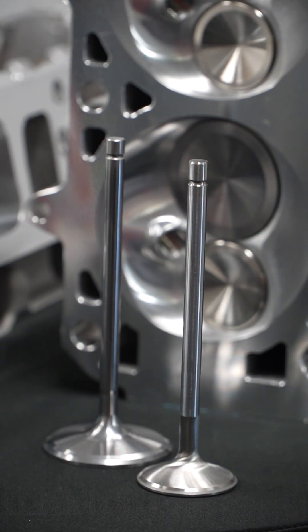The flow on this cylinder head is pretty off the charts — it's flowing over 400 CFM on the intake and roughly 310 on the exhaust. It has a 2.180 intake valve and a 1.630 exhaust. The factory LT valves are 2.125 and 1.600, and we went to a 2.180 and 1.630.